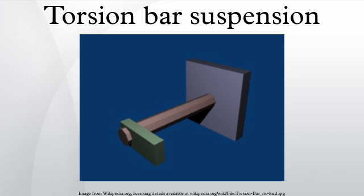Before World War II, the front-wheel drive Citroën Traction Avant had independent front torsion bar suspension and a flexible trailing dead axle, also sprung by torsion bars. The Czechoslovakian Tatra cars designed by Professor Hans Ledwinka in the mid-1930s used all-round independent torsion bar suspension, along with their air-cooled rear engines. Also in the 1930s, prototypes of the first Volkswagen Beetle incorporated torsion bars, especially its transverse mounting style. Ledwinka's concept had been copied by Ferdinand Porsche, whose successors later had to acknowledge the influence of Ledwinka's sophisticated Tatra models on the Porsche design KDF-Wagen of 1938, a post-war lawsuit resulting in a 3 million DM settlement paid by Volkswagen to Ringhoffer-Tatra in 1961.